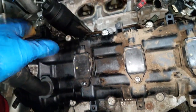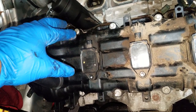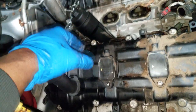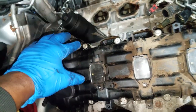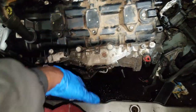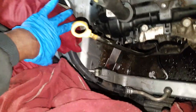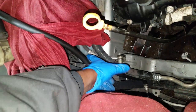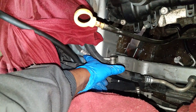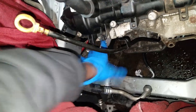One thing that concerned me — remember this van was underwater, which means the AC compressor and the alternator were underwater and they look pretty rusted up bad. I got them stored over there on the table. I'm not sure if that alternator is gonna charge, and I'm not sure if that AC compressor is gonna even run. I assumed the van was underwater about up to this height — the intake air inlet is right here — so the AC compressor and the alternator are both lower than this point and had to have been affected by the water.